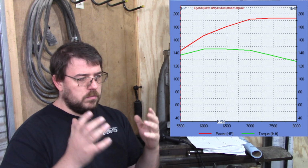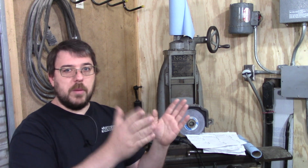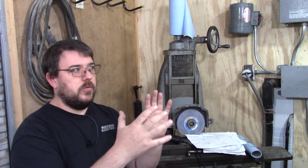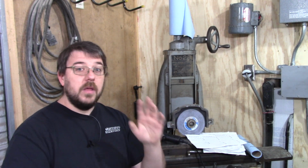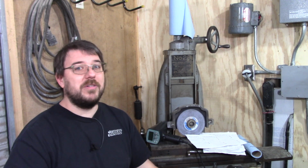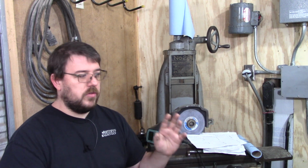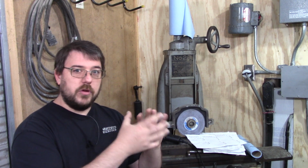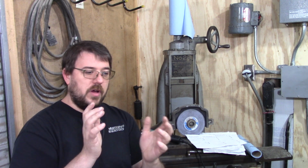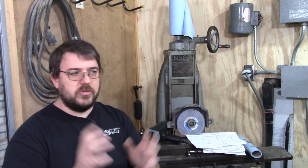But often, actually, I haven't seen a single aftermarket ECU that lets you set different targets for the front as well as the rear bank. So if they're off by different amounts, you just can't make it up in software. Now, I'm sure that's an incorrect statement. I'm sure there actually is an aftermarket ECU, probably the Motec, that can target different VVTI angles, but even that is inconsequential because the way that the VVTI system works, it really doesn't like sitting between 0 and 5 degrees. So if you have one that's 5 degrees off from the other, you're eliminating your ability to use between 0 and 10 degrees on the whole system. So that's still not great, even if you can fix it with the ECU.